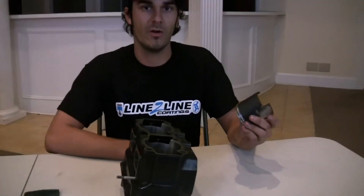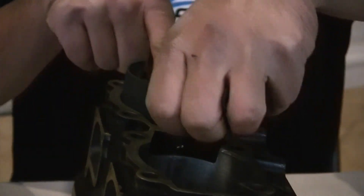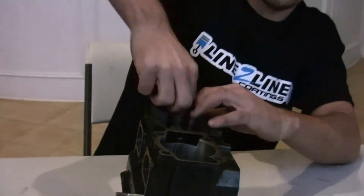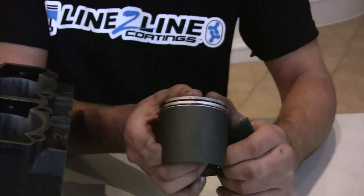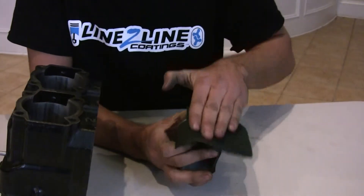This one we coated a bit oversized. And as you can see, it doesn't fit in the bore, so this one needs scotch-brite. Now that you have it back out, you can see that you have shiny spots and the witness marks show you that it's too tight there. So now you want to scotch-brite those.